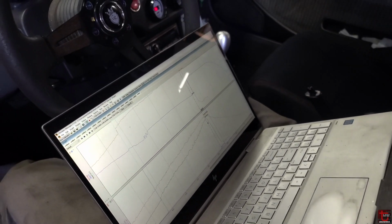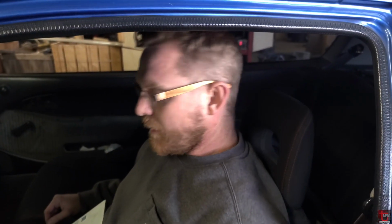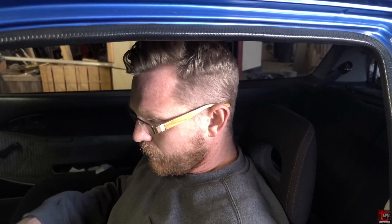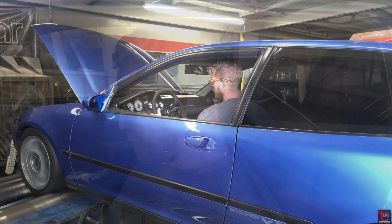we're increasing the fuel pressure right now. It was at 42. It's now going to be at 52 PSI, and we hopefully will get a little headroom bump and extra room to afford some more boost, so we can get some more power out of it right now.